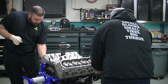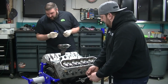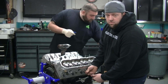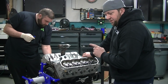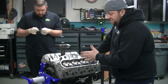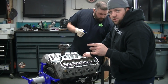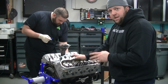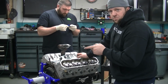These heads are good for a bunch more power from the 799s. What are these? 862s. So if you go and watch Richard Holdner, who, by the way, copied my last video, whether he did or not, I don't care. He put it out literally the day after my valve video. He does a test of 317s versus 799s, and then 799s versus 862s, or 317s versus 862s, which is what I did. I went from 317s to 862s. And the compression bump is worth more power than airflow on a cathedral port head. Once you go into rectangle port, it's completely different. But on a cathedral port head, these heads make the most power because of the compression bump. From the 317s to these, it's like 1.5 points in compression. Smallest valves, smallest chambers, but make the most power.